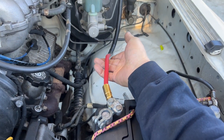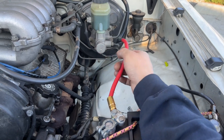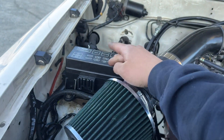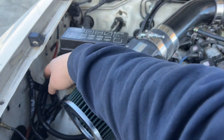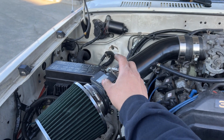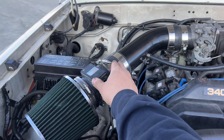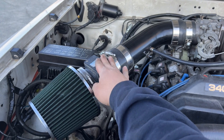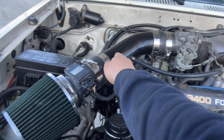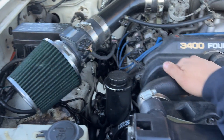I put a new positive wire — you guys remember the previous setup had a big old green wire. Now this is a nice hot wire that goes from the battery straight to the starter, and then another hot wire that goes from the 80 amp fuse straight to the starter. Much cleaner. I was also able to get another MAF from my Toyota gearhead friend. Even after swapping the MAF, it's still having the problem, so we know for sure it's not the MAF. I'll keep that original MAF and air filter as a spare.